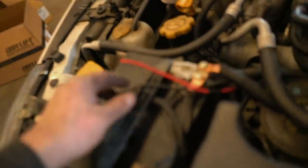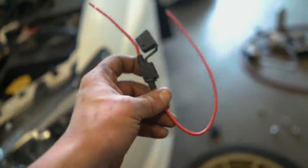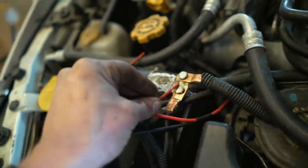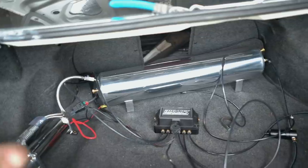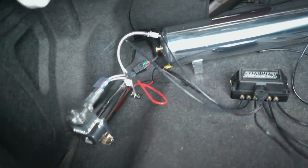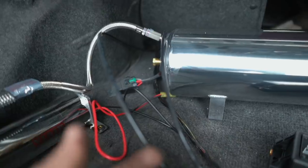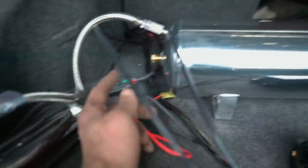The very last thing to do is take out the plugs on the tank, put thread sealer on them, get them tightened back up, and connect the controller. But first we have to connect these two wires to the battery — black goes to ground, and before we connect the red wire we have to throw in this fuse, crimp it on, throw the fuse in, and then the other side connects to the battery. We also have to figure out a remote turn-on for the pink wire. We are going to check the system for leaks — just squirt soapy water on a fitting, and if it starts bubbling up, it's leaking.